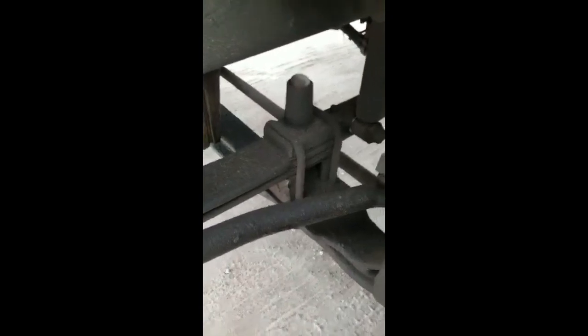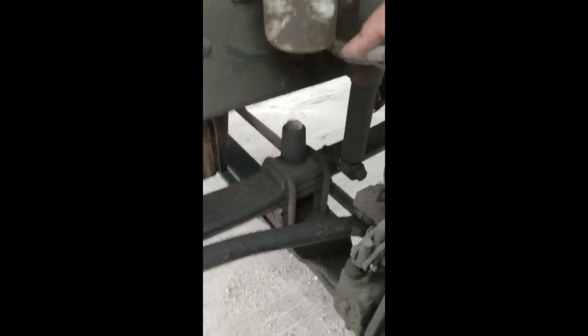Saddle is properly mounted and secure to the axle with the U-bolts. U-bolts are properly mounted to the axle and no missing nuts. Axle is in good conditions. Not dent, no illegal welds, no illegal repairs.